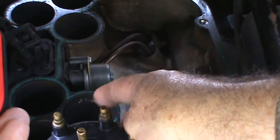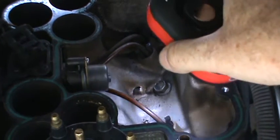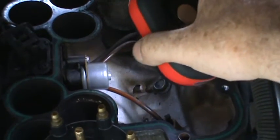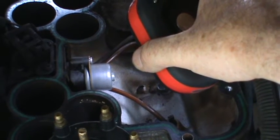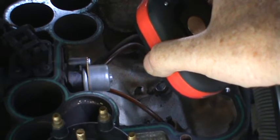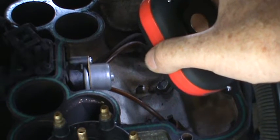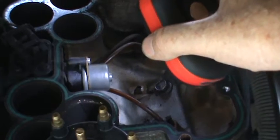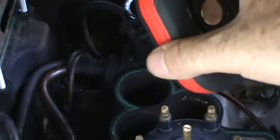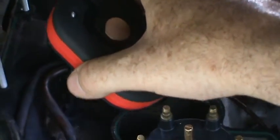What they're always saying on the internet is watch for these shiny spots with this aluminum lower half. I've got an LED flashlight here - hopefully it'll comply - and we'll shine it down here. If you notice, off to the left here you can see where the air goes down into here; it's all black and carboned up. Now if you have a fuel leak of any kind, it's almost like sandblasting - when the engine is creating a lot of vacuum and the fuel is puddling down in there. On the other side you'll notice it's just all carbon black with no leaks.